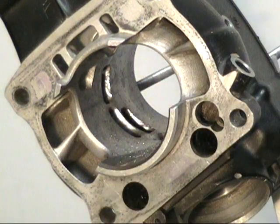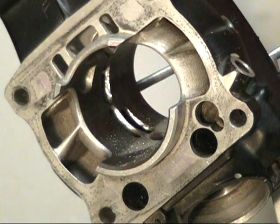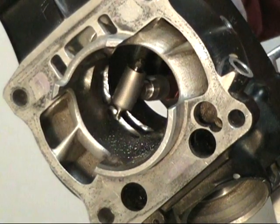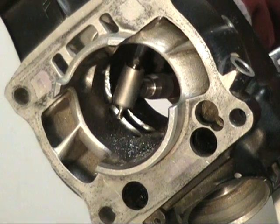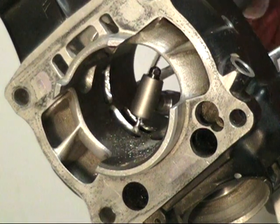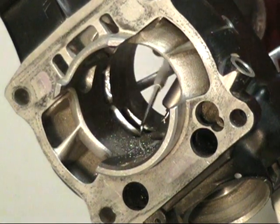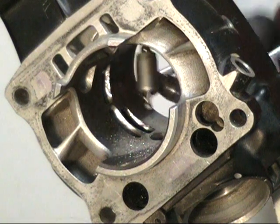Now let me show you how that works — what this is called is the contra-angle. So we're up here on the contra-angle, and we're going to work that port towards the intake side. Because the left-hand cut burr is cutting towards this side, it pushes towards it and makes it nice and smooth, whereas the right-hand burr is good for moving towards the other side. It's just deciding which one you want to use.